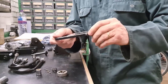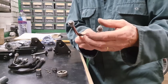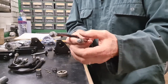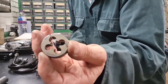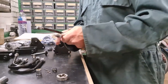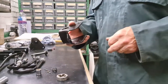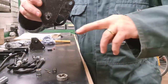I'm preparing to put the axle back on now. The first thing I'm doing is making sure all these threads are nice and free, because they will give a torque reading. If the nut is really tight on here without anything clamping, then the actual torque you do it up to is going to be less than the torque wrench says because it's tight just doing the nut up. So I've got a 7/16 UNF die and I went down all the threads, put some oil on them, and they're all nice and free. I can't see any torque settings for these but I'll use my experience for that.